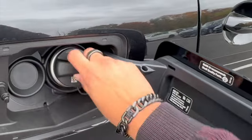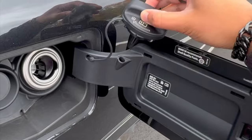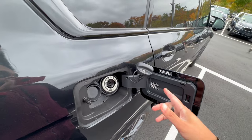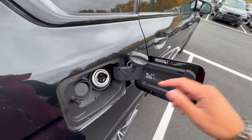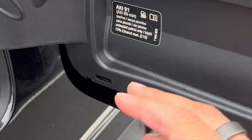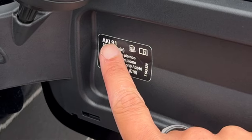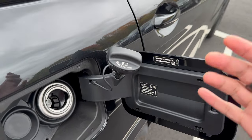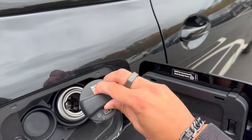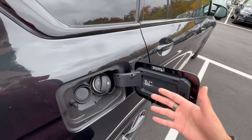If you're wondering what kind of gas to put in your X7, check the sticker located right here to see what type of fuel your vehicle needs. BMWs are typically mid to high octane — your absolute minimum is 89, your recommended is 91, and you can always go higher. This is a BMW M vehicle with a sportier engine, so BMW recommends Shell. I personally recommend Shell as well — for some reason their gas just makes the vehicles feel a lot more powerful.